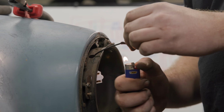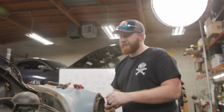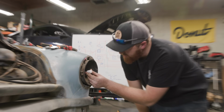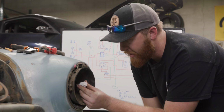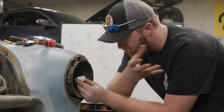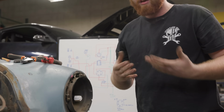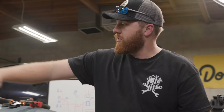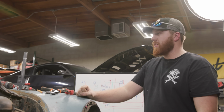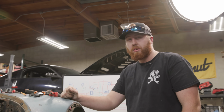If you haven't been keeping up with what I've been up to, it's been this for like 6 hours, so you haven't missed a lot. Right now I've moved on to headlights. I'm wiring in some new pigtails that we picked up from O'Reilly's. These will allow us to put our new 12-volt headlights into the car. The old pigtail was a little bit different shape, and just like everything else, completely powdered in your hand. So we get these wired in, run some wires back there, and then the front of the car will be done probably midday next week.